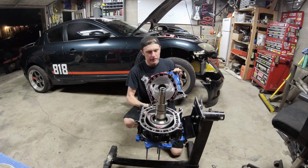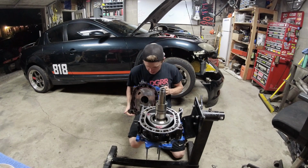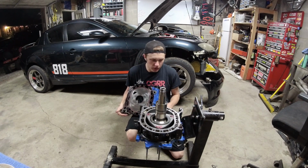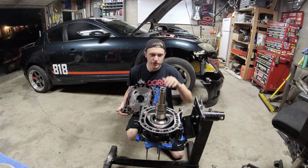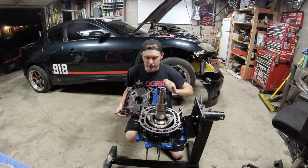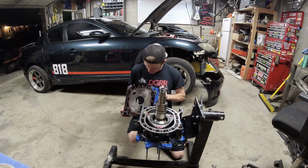Once you know that you've got your coolant seals in the center iron and they're not going to fall out, you've got your dowel pin O-ring on, you have your apex seal corners in, you have your corner seals, all this rotor stuff assembled. Your E-shaft is in the correct direction. This is your last chance to change the E-shaft direction. You've got your dowel pins in. You got your silicone on your little legs of the housings here. You're ready to put the center iron on.